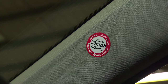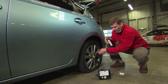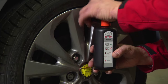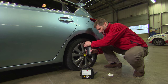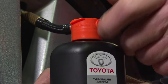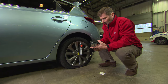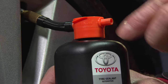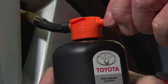There's another sticker which must be applied to the A pillar to remind you to change the wheel at the next opportunity. You then take the bottle, remove the valve cap, and screw on the sealant bottle. Make sure you do it up securely so there are no leaks.